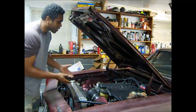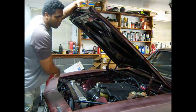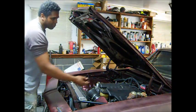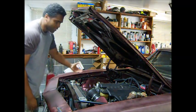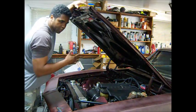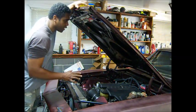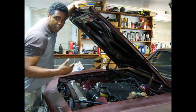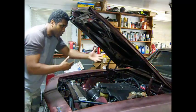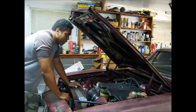But when you get a car, sometimes you open up the hood and you see wires all over the place — some wires taped together, some wires just spliced, wires just hanging around. So just take that equation out. If you can, get yourself a brand new wire harness for the whole car, because they even sell it in separate sections — you got your intermediate wire, your rear wire, your interior wire. You can buy the harnesses separately for the car, and it just makes it so much easier. The best part is they come labeled.